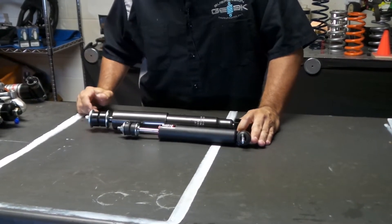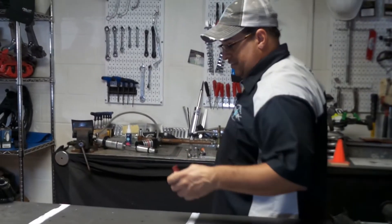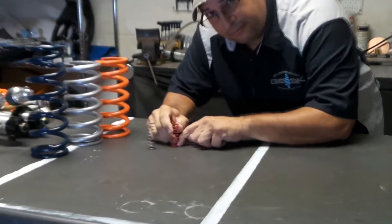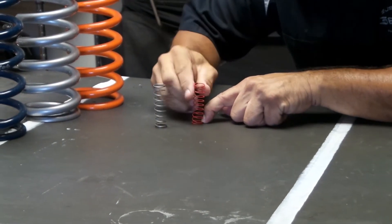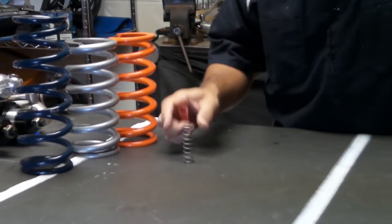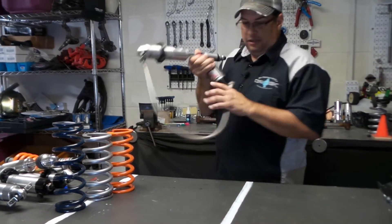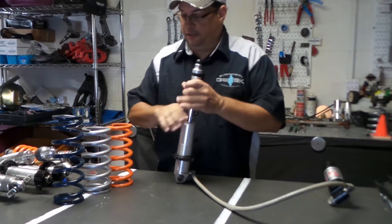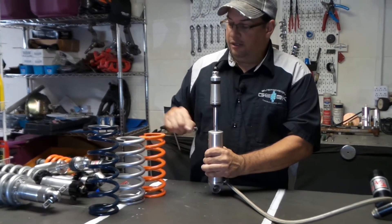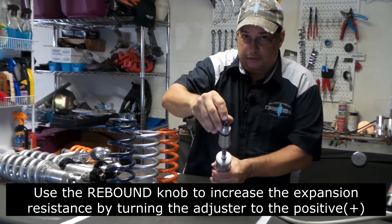The reason shocks come out slowly is to control the springs. A spring — regardless of color or size — has one objective: it pops back up. The heavier your spring, the higher it's going to pop, so you need to control that movement. This is why you hear guys say a shock is a timing device — it's really more of a speed controller. With a heavy spring on an adjustable shock, it pops up really fast like the old style, but you need to slow that down.